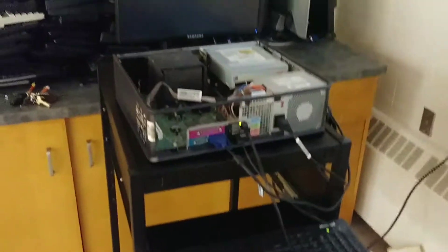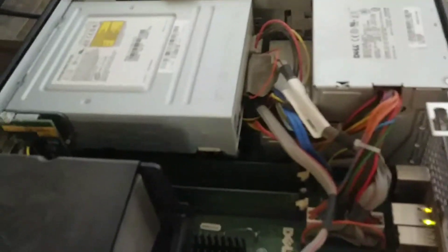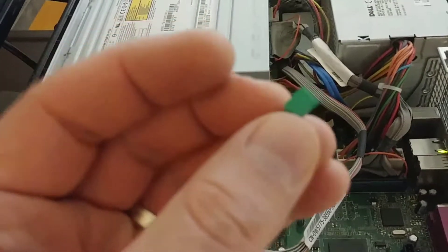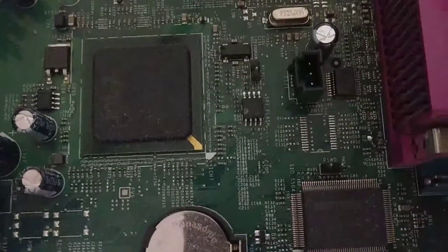Good morning. This is a small example of what you might need to do on some of the older desktops that you may have pulled from recycling. This old desktop actually had a BIOS password and I had no idea what it might be, so I had to open up the desktop and remove this little piece of plastic called a BIOS jumper, which was positioned on the motherboard.